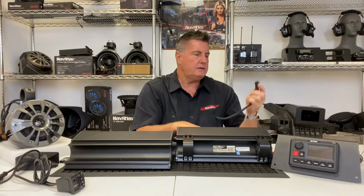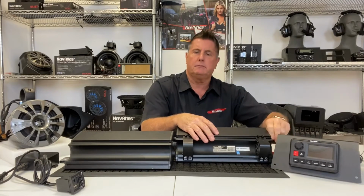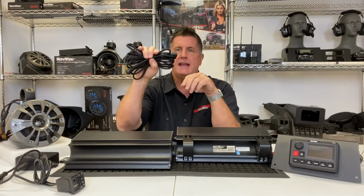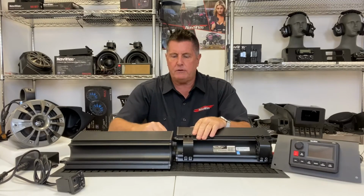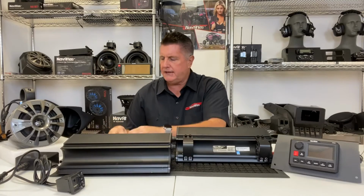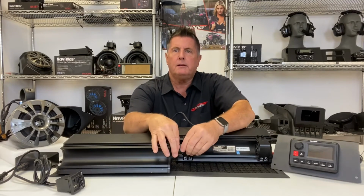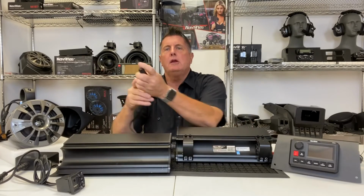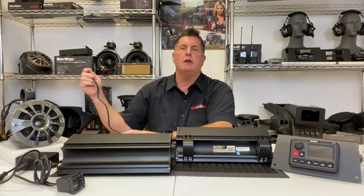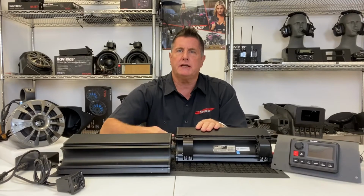Signal in to your side of the soundbar from your source unit. Take the A to A cable from the signal out on the side of the soundbar and the signal in to the second soundbar. And you'll repeat that multiple times if you'd like. So you go from this soundbar to another cage speaker to another soundbar. So that's daisy chaining. I have the ability to do a digital signal as well,